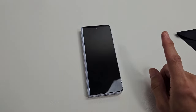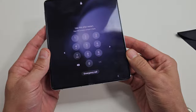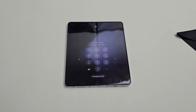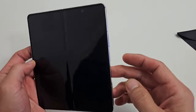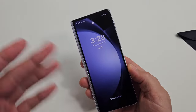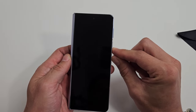The last step I have for you is what I call the freezer method. Open your phone up like this with no case on it, and put it in the freezer where it's nice and cold. Leave it in the freezer for 15 to 20 minutes. After 15 to 20 minutes, take out your nice cold phone, tap that power button, and see if your screen is on — check the front as well. Still a black screen? No problem. While it's nice and cold, force restart it: volume down and power, press and hold both buttons together and wait until the Samsung logo appears.